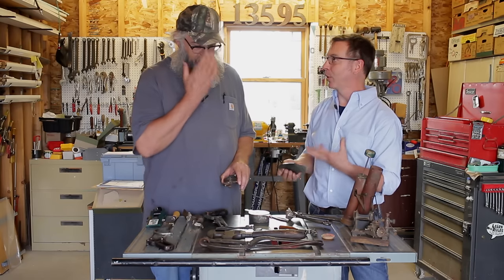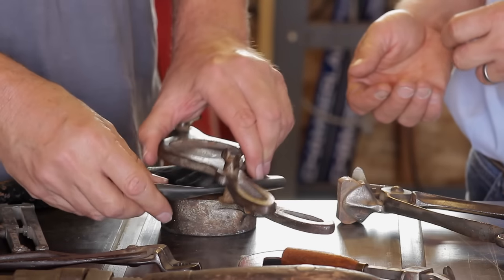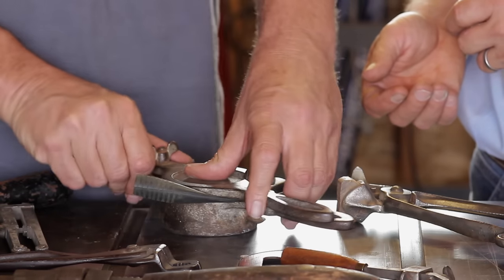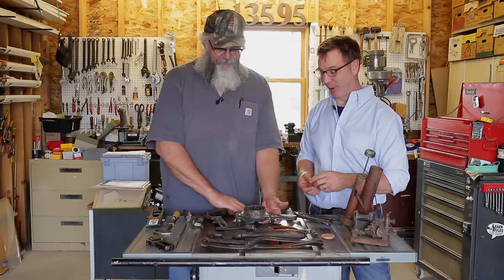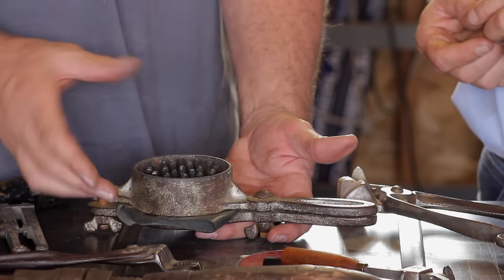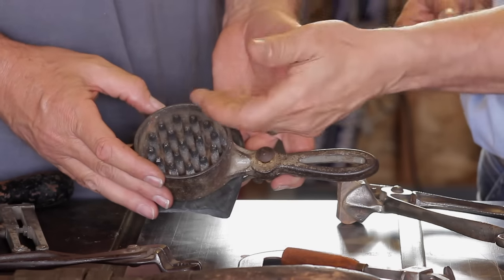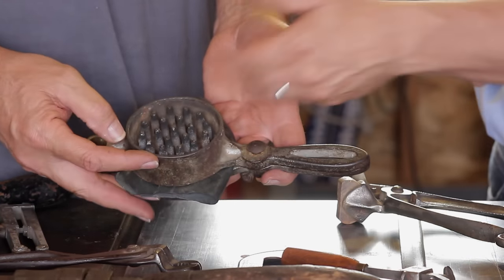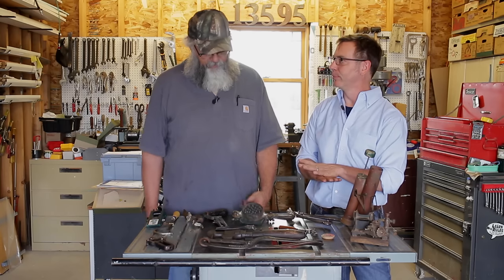It wasn't on a chemical melting process like it is now. So you would put the tire in there, or the inner tube. Turn it over. This is the exciting part. Fill this with gas and light it. And that'll heat up your tube and vulcanize it. The pins will transfer the heat evenly throughout. The pins help transfer the heat and melt the patch onto the inner tube.